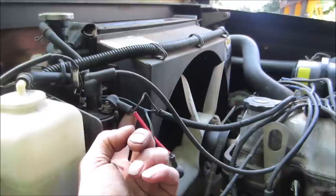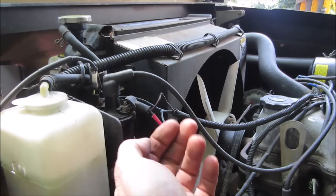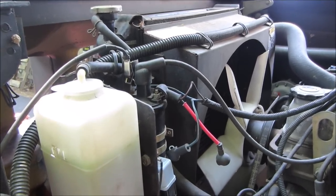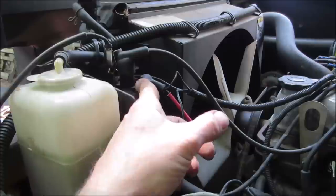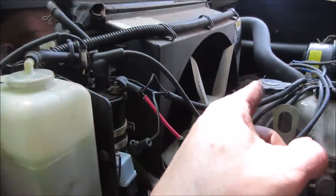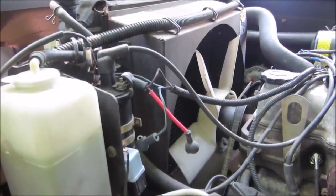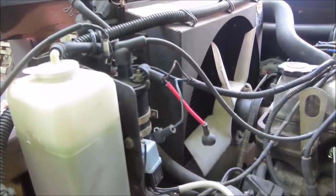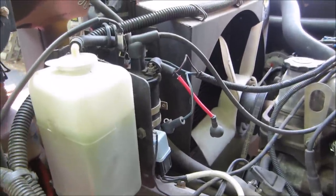This might be getting too much voltage, especially as it starts and warms up and the charging system numbers come up. I wonder if I could find some kind of potentiometer and dial it down to say maybe 10 volts and just try it again. I'm suspecting that pickup right now. The manuals I have are for a 1979 - this is a 1992 - so they're not the same, they won't help us look up what it needs. So it's up to us to try to figure it out.